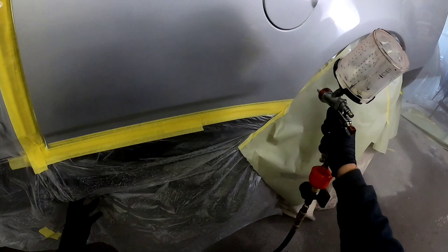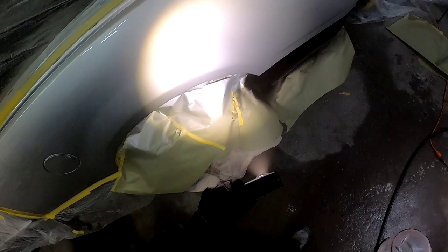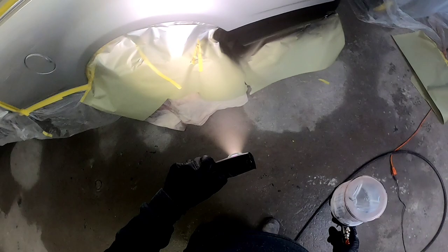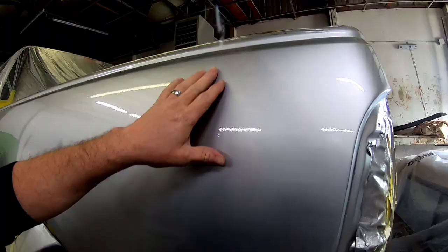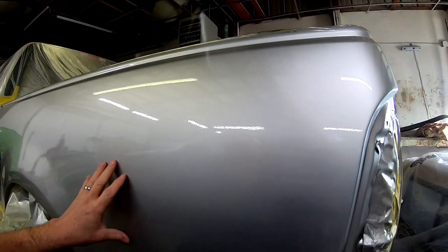Now I'm just taking a good look with the sunlight at how those metallics laid down and what it's going to look like out in the sun before I start wet sanding and buffing it. I do notice there's a couple little particles of dust, but let's take a good look at this paint job. You can see a little bit of texture or orange peel at the top of this bedside — we're going to cut and buff that in the next video. Overall though, this finish looks beautiful. It laid down nice and the Kiwami gun sprayed really well. There's a little bit of a learning curve to it, but overall I'm really happy with how it sprayed and how it atomized the clear coat and the base coat.